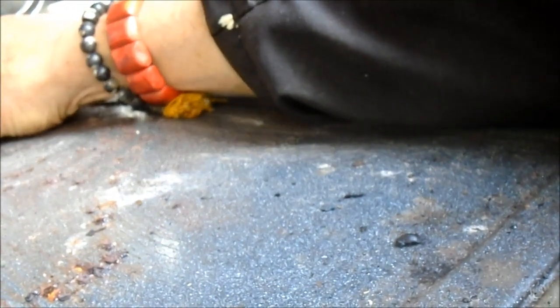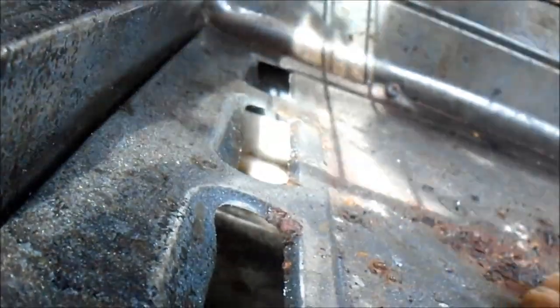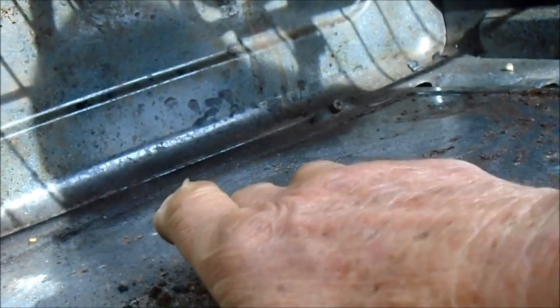Now let's look down here — I can see a glowing inside. Take this out and look at it. Usually if this thing glows for longer than a minute and doesn't light, then you need to replace the igniter. I can feel it getting hot right here in the center, so this one should be good.